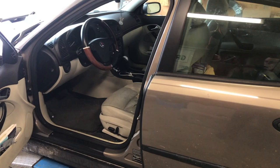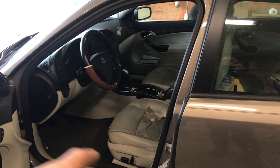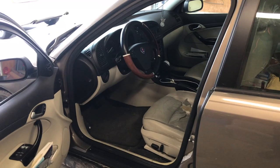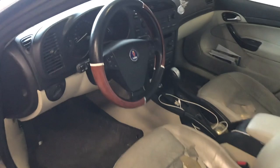To summarize, it's a 2004 Saab 9-3. This vehicle has a common problem with — I believe it's a CIM module — something goes bad with the column lock or the ignition. Parts are really expensive and it requires a bunch of special tools and equipment to program. Once you replace that module you even have to have a computer with Windows XP and a General Motors Tech 2 with Saab capabilities. Anyway, the list goes on and on.